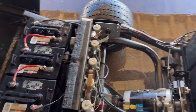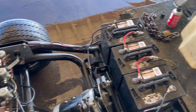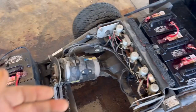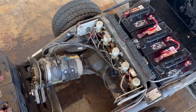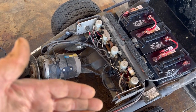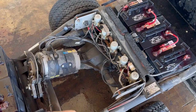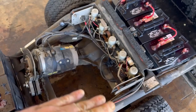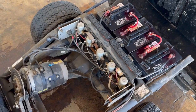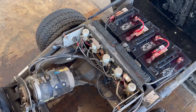Kind of let them dry and we'll put some battery protector on these. So instead of having an electronic speed controller, it's just got a bank of solenoids. It's kind of neat how it goes from low speed to high speed — there's a wiper arm in there, kind of like a rheostat, and it senses voltage and opens up or turns on different solenoids as you're going.